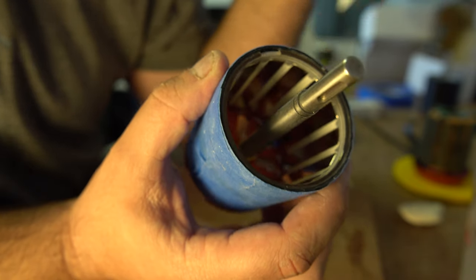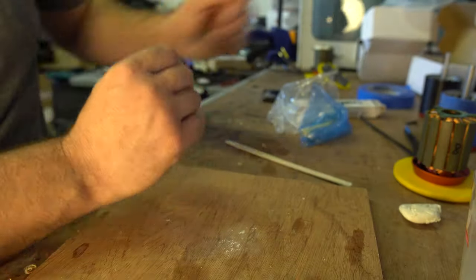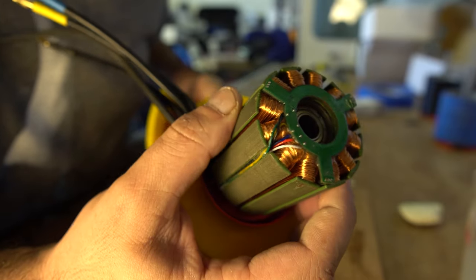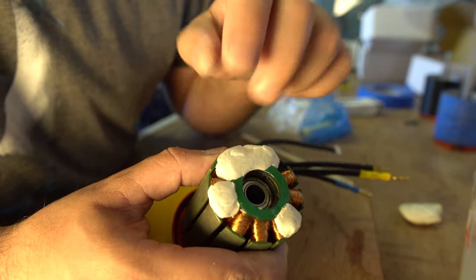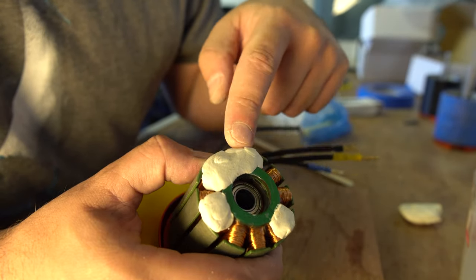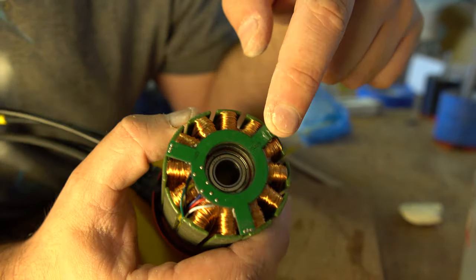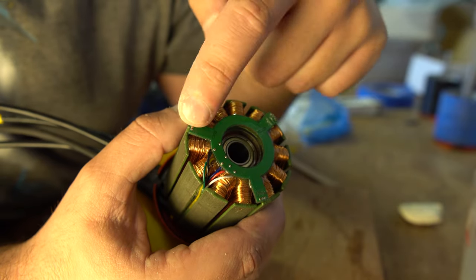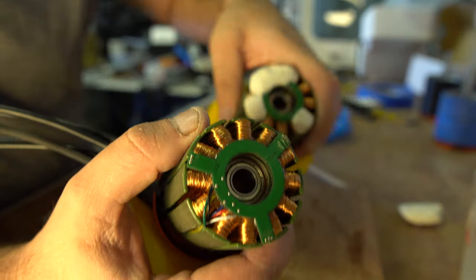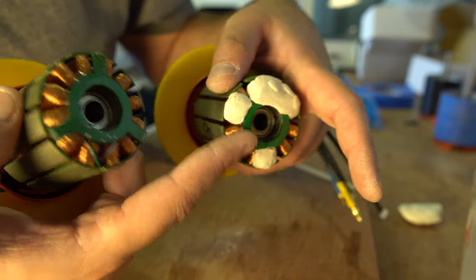Once this epoxy goes off in about two and a half hours those magnets aren't going to move - they won't get knocked off easily. That's stage one. For stage two you can protect the PCB and the hall sensors with epoxy. There's nothing metallic in this epoxy so you should still be able to read the hall sensors with them covered. These bits are vulnerable to water causing shorts on the wires and terminals, so you can cover these up - a rubberized glue might be better but epoxy works too. You get quite a bit of space between the can and the end of the stator so it won't interfere.